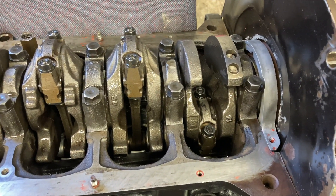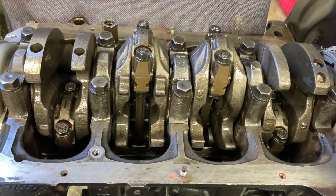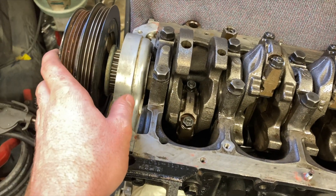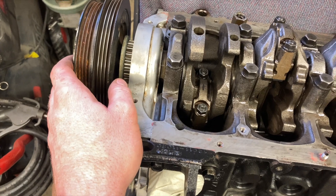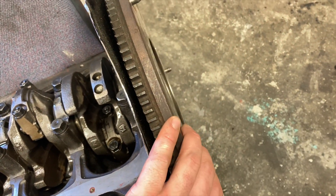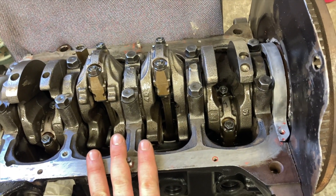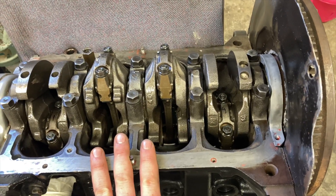After all that work we finally got our 4E crank into the 2E engine. Everything rotates nicely so I can turn it pretty easily by hand. This side of the engine still needs to be reassembled — the oil pump and whatnot needs to be assembled properly. We've got our flywheel torqued down, so that just needs a clutch on the end. And of course we need the oil pickup and sump. This engine is pretty much ready to run. Thanks for watching.